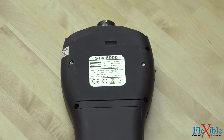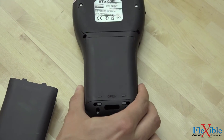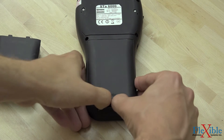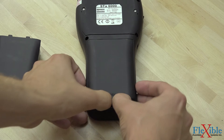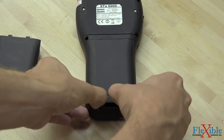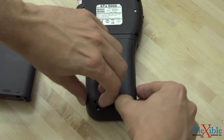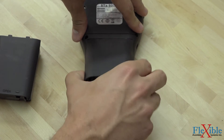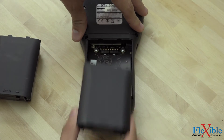Let's install the battery now. On the lower back plate there are two tabs with arrows pointing outwards. Simultaneously pull both tabs outwards and the plate should unlock and pop up. The tabs are tricky to pull apart if you use the pads of your fingers — I use my nails to get a grip on them. Once the lid is popped, gently lift up while pulling towards the tabs to remove it and place it to the side.